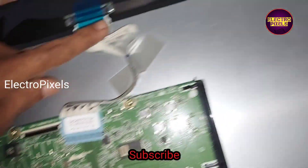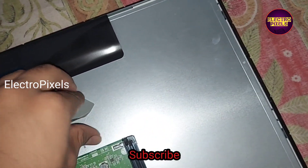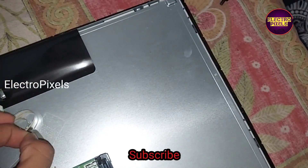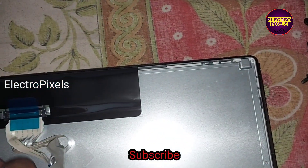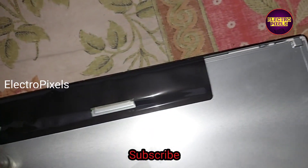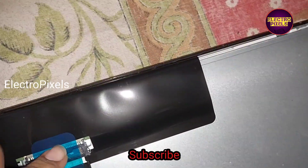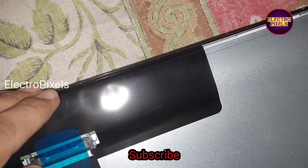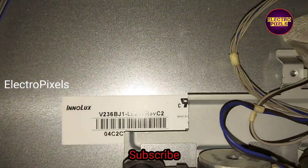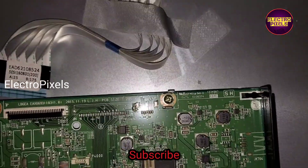The length of the LVDS cable is short, so we need to replace the LVDS cable also. Both model TVs have the same panel — model number INLX V23BJ. Since both TVs have the same panel, the LVDS connection will be the same. Now we replace the LVDS cable.